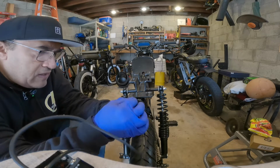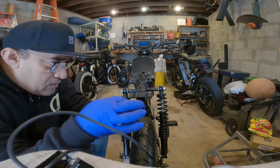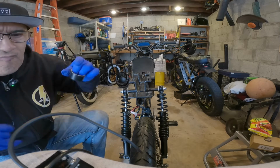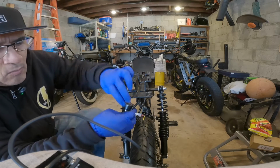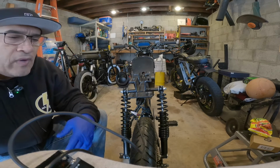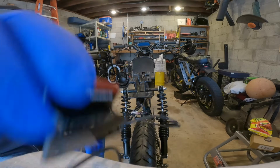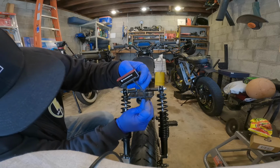Okay, so here you'll find the positive and negative of my turn signals. All I want to do is isolate the two of them because they're just going to get tucked inside there. Alright, once those are insulated, I can just tuck them inside here and pull them out when we're ready to install the turn signals. And all of this is going to get tucked inside this pipe. So once the wires are nicely tucked inside, I can continue to install the SUPERNOVA.